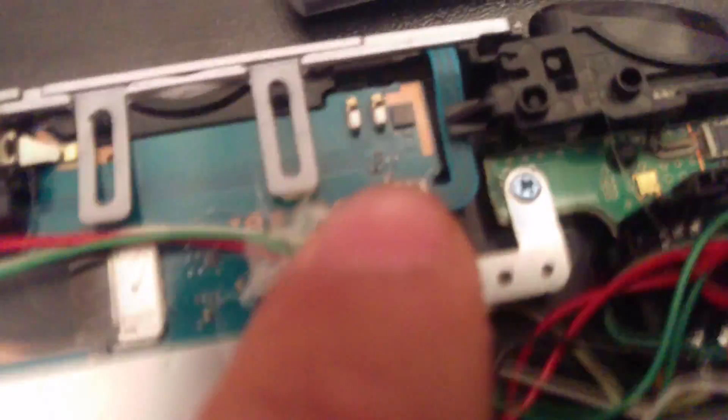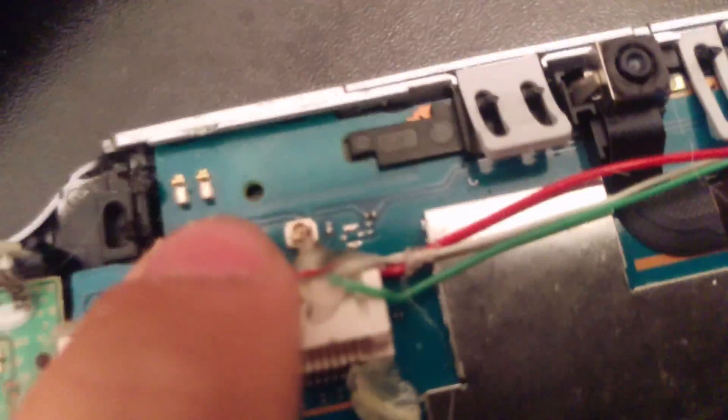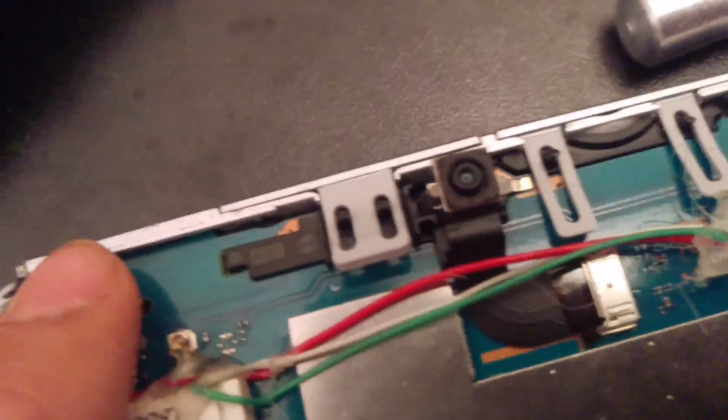You just remove this antenna. One of the antennas you don't need — these are the antenna prongs. For anyone looking for extra space: trace them — this one connects to there, goes through to here, and goes to the other layer of the board. This antenna actually goes to this one. The two antennas we don't need are the big one here and this one, and removing them doesn't affect your Wi-Fi at all.